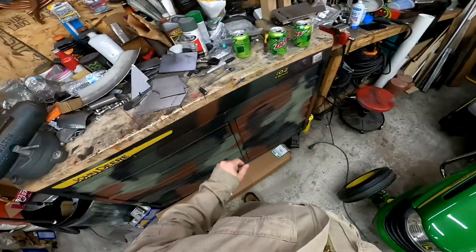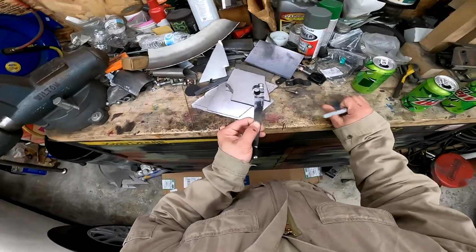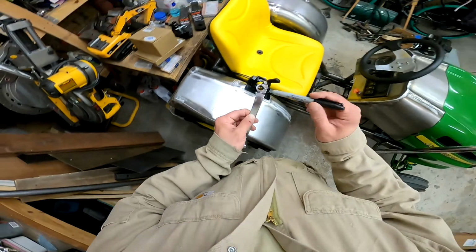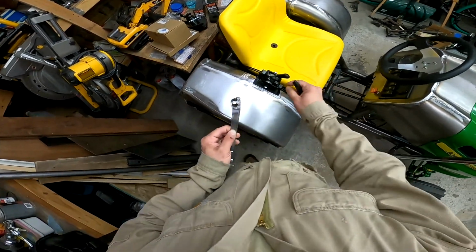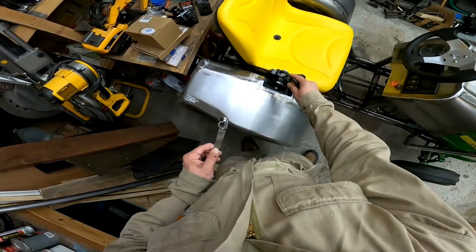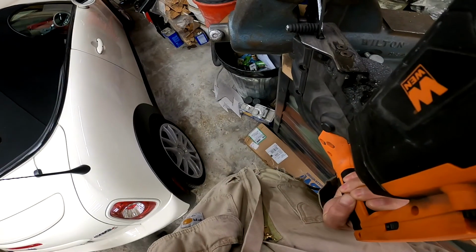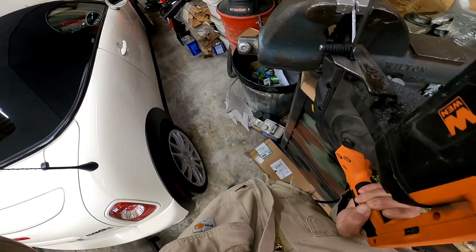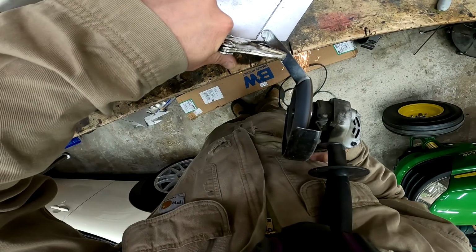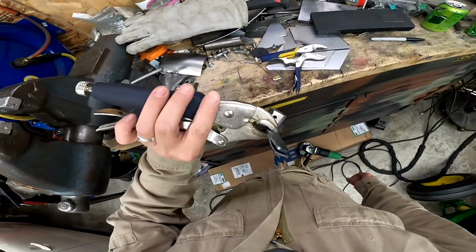Welcome. It turns out same video, next day. I'm gonna do something with this. So I was thinking about it. In here, my pivot's like 1 inch, which would put it out to probably about here to be the same throw here. If I go out to here, I could put it here, which would almost double that, which would give me more leverage. It would make this a little easier to move. All right, welded up. Still hot.